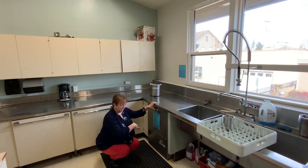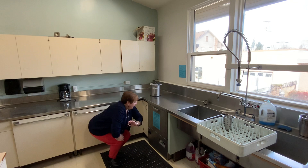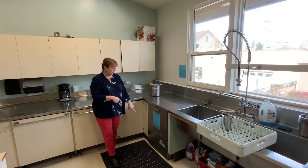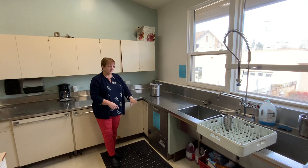When you're ready to clean everything out and you're done, you don't have to put anything in there. You're going to latch it again, and instead of leaving it, when you latch it, it's going to start through a cycle. But you're going to hit the off-drain button — that's the toggle switch with the on-fill. Hit that off drain, it will go through a cycle draining the machine. You need to wait until that green light goes off, then open the dishwasher and leave it open to dry before you leave.